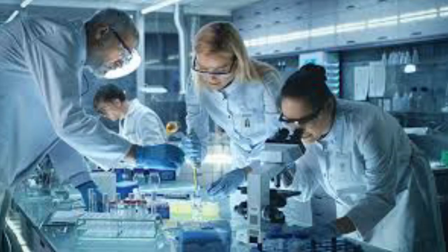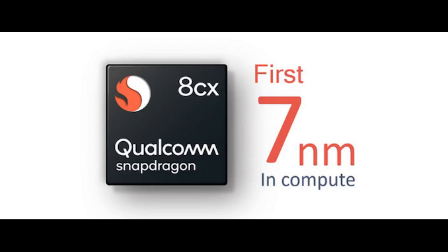The SQ1 is not an entirely new or different processor. It's actually more of a hybrid processor based off the Snapdragon 8cx, which has incremental updates. The thing that sets the SQ1 apart from the 8cx is it features an Adreno 685 GPU rather than a 680, which is an incremental update, and it makes sense as to why it's on the Surface Pro X since it's a 2-in-1 device running Windows.